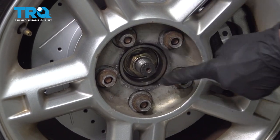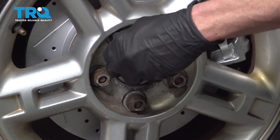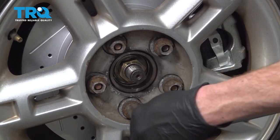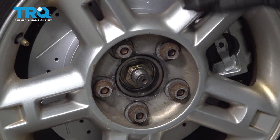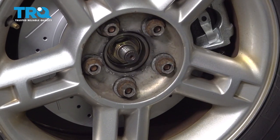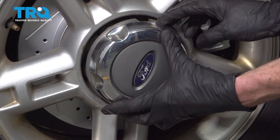With the wheel back on the ground, let's torque the lug nuts in a criss-cross manner to 100 foot-pounds. If you had a center cover, go ahead and put it on now — you can see the areas where all the lug nuts need to fit into. We got one side of the truck done. Now you're going to want to do the exact same thing on the other side. After that, go ahead and test your emergency brake — make sure it holds the vehicle while it's running in drive with your foot off the brake. Assuming that's good, take it for a road test and make sure you don't hear any funny noises. Thank you for watching.